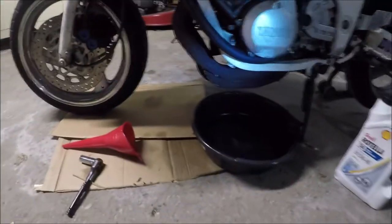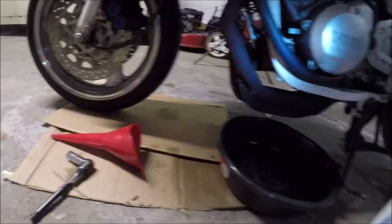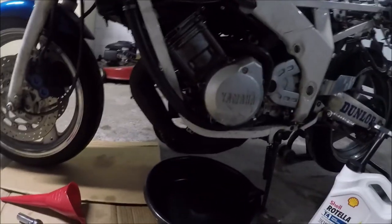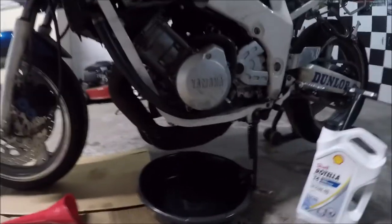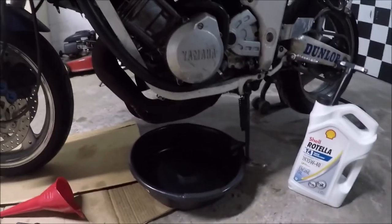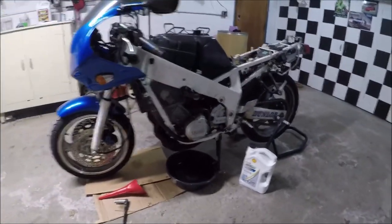You don't really need to see me do the oil change — it's pretty boring. I'm just going to drain it out at the 17mm drain bolt, pull off the oil filter, and swap in some new Rotella T4. I think I should just cut this video into two because this is enough for me this weekend. I'll get back to it hopefully next weekend and finish it up, and then it'll be ready for summer. Thanks for watching.